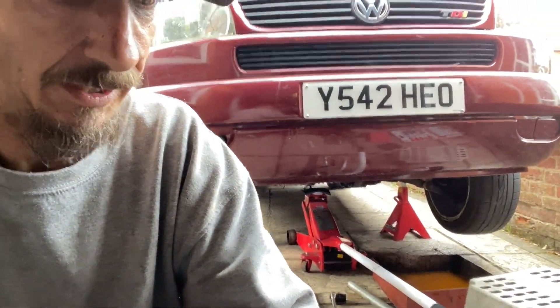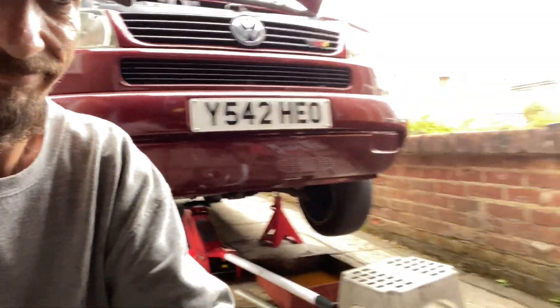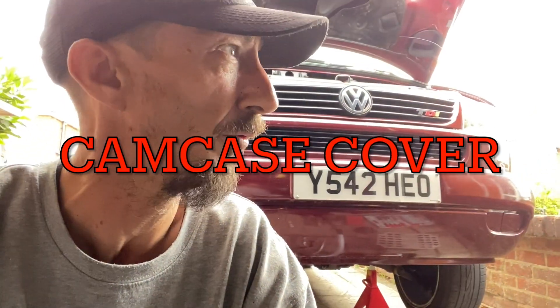I've already drained the coolant and the rocker cover is off. I was just making some checks to make sure that when I put the turbo on everything's going to be all right. If you want to see how to do the cam belt, water pump, and diesel pump belt, I'll leave a link below for previous videos where I do the timing belt and set up the pump timing.